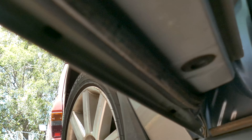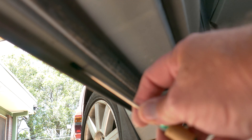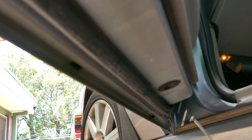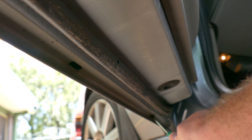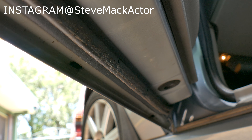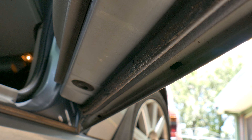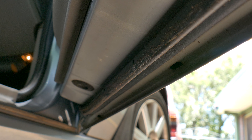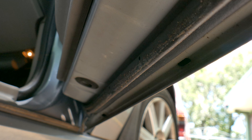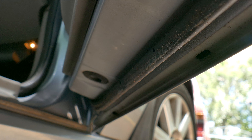There are more drain holes further along — go to each one and do the same, making sure they're clear of any rubble. Water collects in those every time you lower the windows in the rain, and a tiny bit of water will get in and end up in the bottom of your doors. And you know what metal and water do when combined: rust.